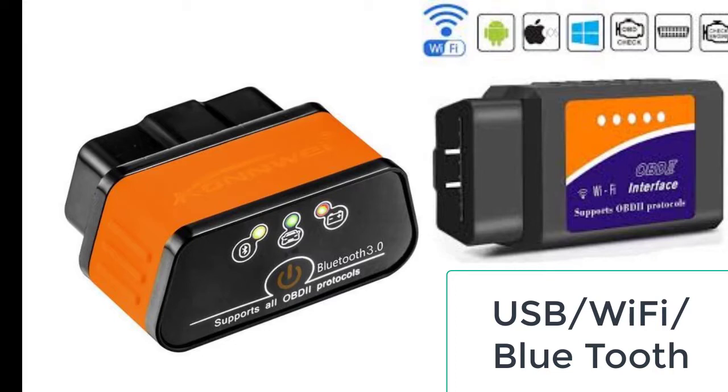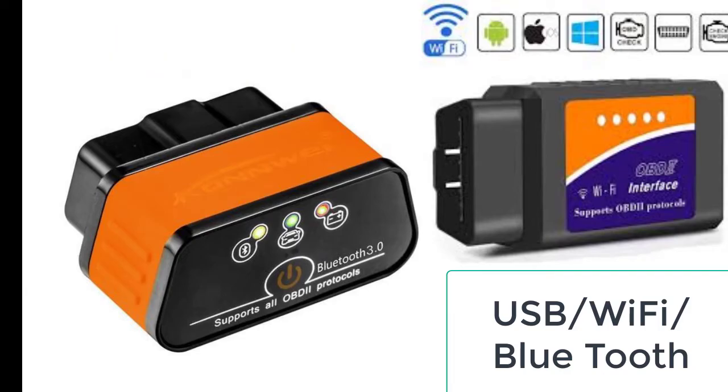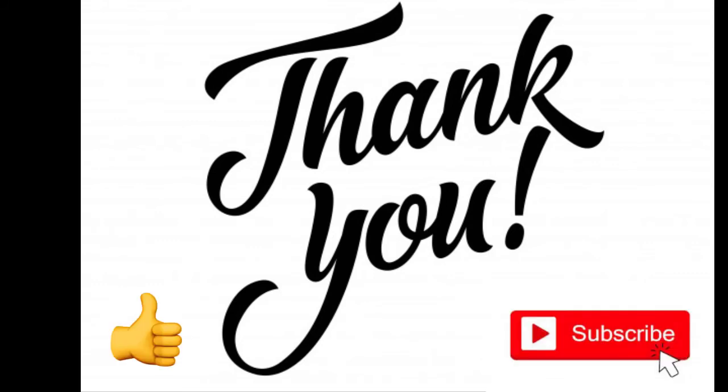I would recommend, before you start working on this instrument cluster, to have one of these onboard diagnostic connector scan tools — the ones that use USB, Bluetooth, or Wi-Fi are preferred. The little handheld units usually do not give runtime information; they're used to reset the MIL indicator and read error codes. As always, I hope you enjoyed this video — it was a little more challenging than I expected, but that's the way life is. If you have the same problem, just take your time and go for it. If you like this video, please hit subscribe and maybe give me a thumbs up — I really do appreciate it and that gives me the motivation to keep the videos coming. Thank you again.